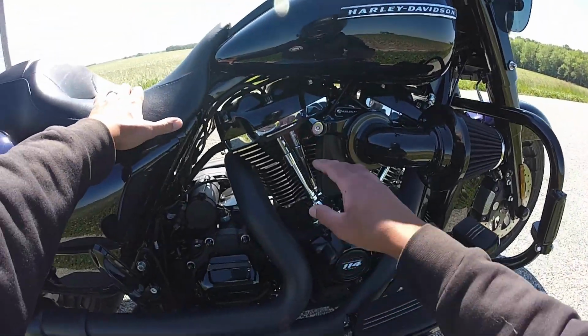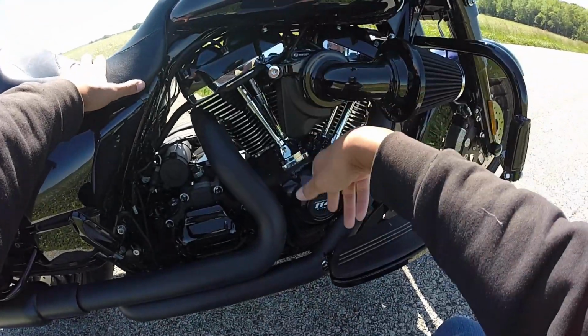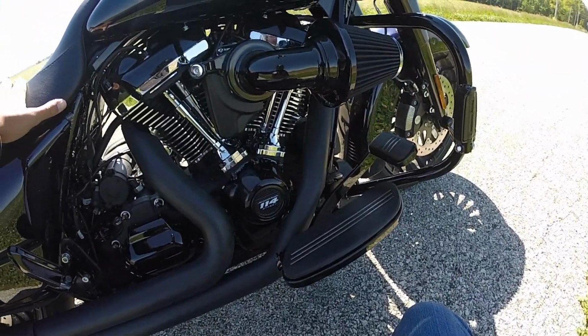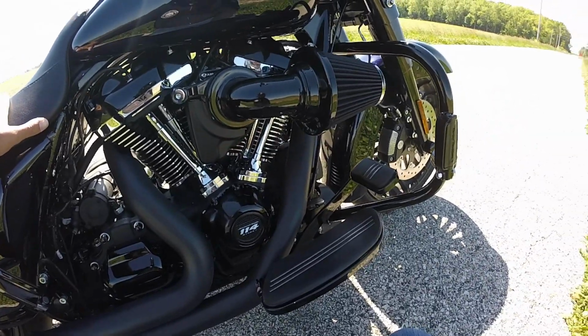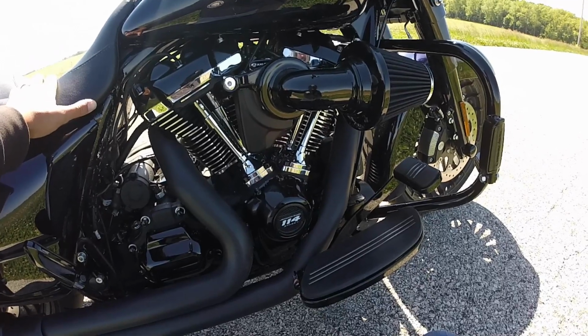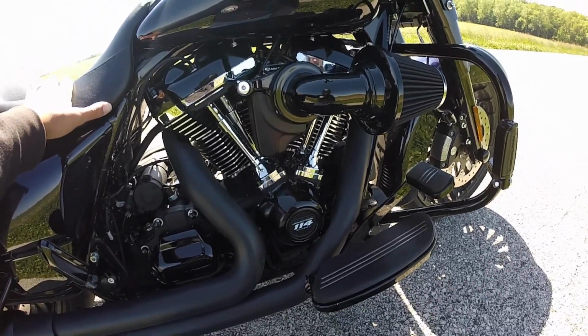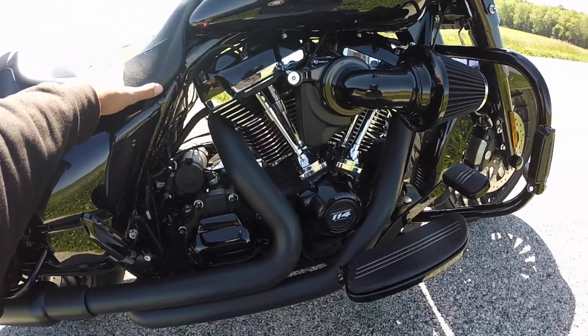So I ended up taking the entire everything apart and then using my stock push rods. I have SNS premium lifters. I did not change the cam plate or the oil pump. I didn't feel a need to for the way I'm running my bike. I can always change it later, but it's not required.